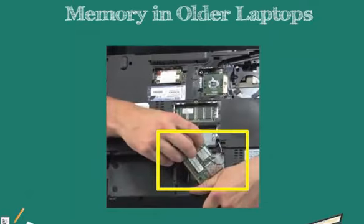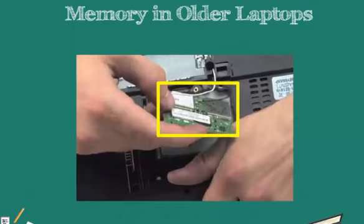This antenna here is removable and can be removed just before we remove the card and put on a new one, rather than having to rewire the entire antenna structure. If you take a closer look, you will be able to see the make and model of the card, which makes it easier to identify and replace when required. You may even want to open up the laptop and find the actual model of that card to make sure you get the right one.